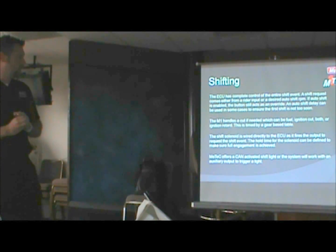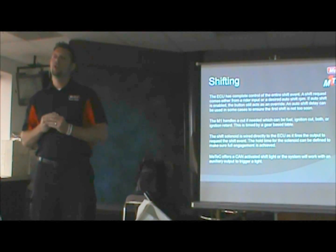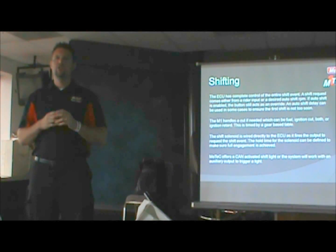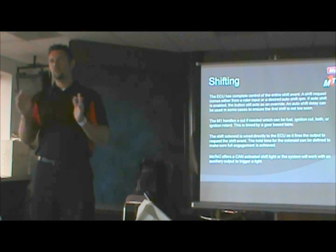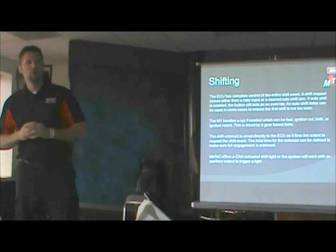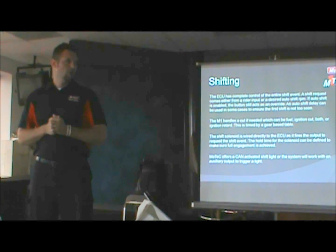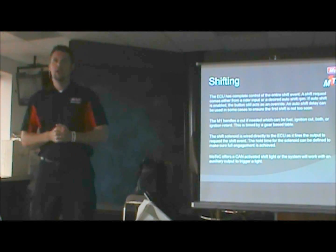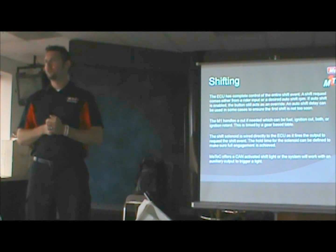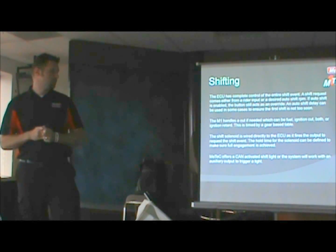Alternately, there's a single RPM value that you can put in, and if the ECU sees that you're not on anti-lag or a two-step or anything like that, and then there's a series of small delay checks that go on. Once it hits that RPM, it's going to shift for you automatically. One note on top of that is if you need to short shift for some reason and you have the auto shifting mechanism turned on and you press the button, it will still shift. So the button is still a manual override for the automatic shifting system.